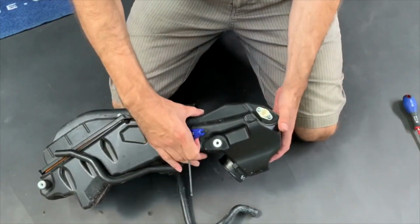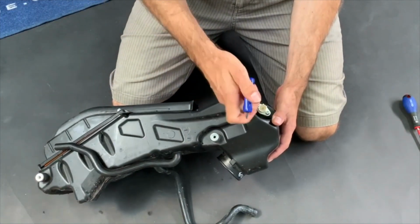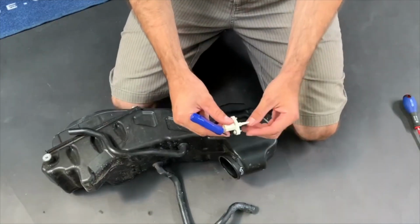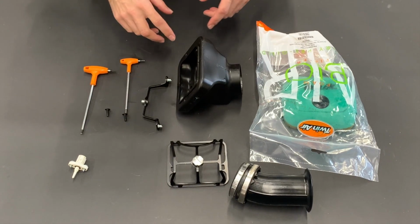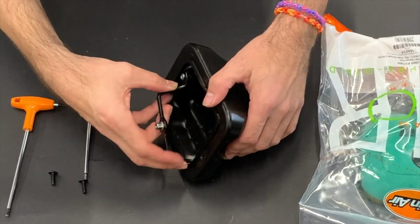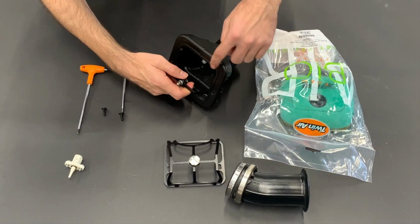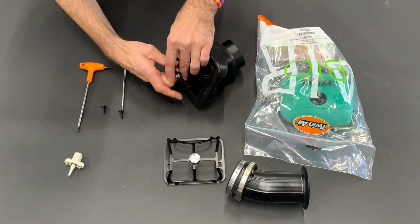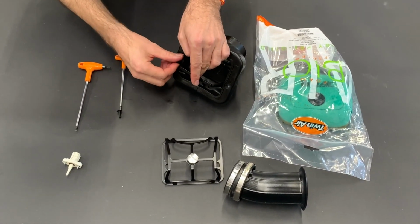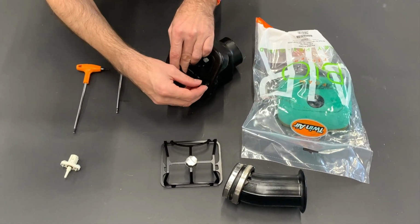We need to use also the gauge for the temperature sensor. So just remove the screws. And it's out. Now we will assemble the small airbox. First we take this reinforcement bracket, we enter it diagonally and we get it like this under the rim. Now we take the M5x16 bolts and we bolt on. There are rivet nuts in the bracket, so it's easy to bolt on.